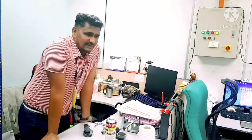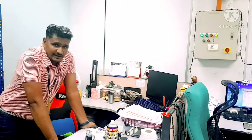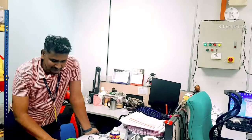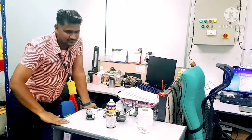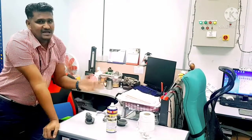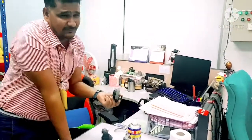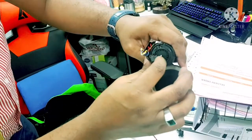There are some other reasons for issues. If the motor is okay, gears are okay, wire is not broken, and everything is normal, but your Deebot is still turning — or moving very fast to one side when it should move slowly forward — this is a counter sensor issue. If your Deebot is turning to the right side very fast, it means the right side counter sensor has a problem. All Deebots have different types of counter sensors. In this model I show you here, there is a gear and a counter sensor, and this part between them is used to count the wheel rotations.